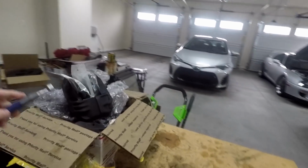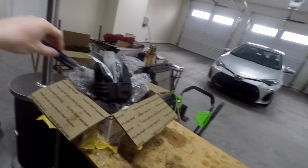One thing I wanted to show you is I found out that the rear calipers, since they're all dug down in there, are 100% aluminum. I didn't realize that. I thought they were all cast iron. I always was told TT brakes are cast iron. Not true. The rear brakes of the TT brakes are 100% aluminum. The rear half of the front brakes are aluminum, and the front half of the front brakes are cast iron.